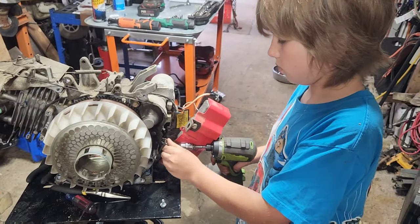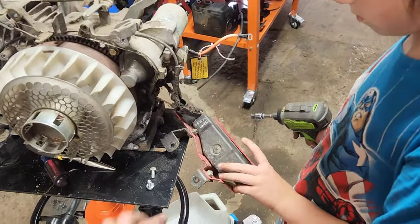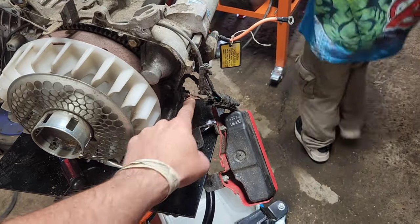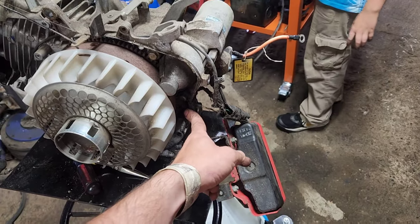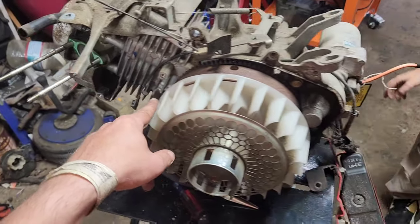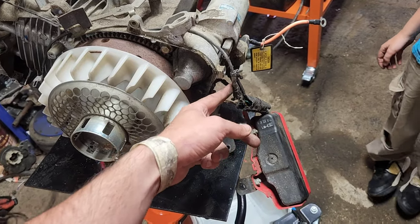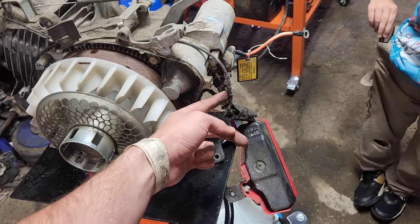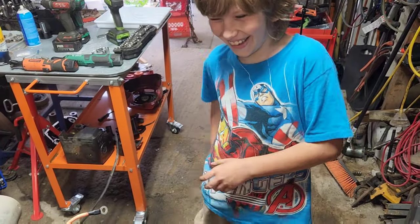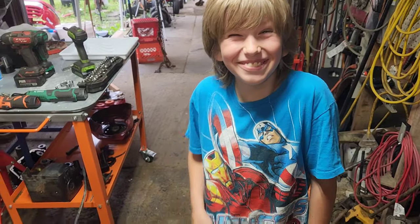So what size was the electrical box bolt? 10 millimeter. What we're getting into here is the electrical start and everything. This wire is your charging wire coming from underneath the flywheel. This wire here is your kill wire going up and over to the coil we removed. John's going to see if he can get this disconnected — there should be a butt connector here that you just pull apart. You're not slicing it, put the pliers away. Don't choose violence.